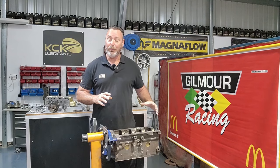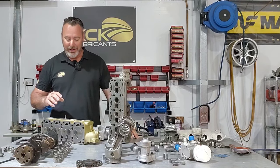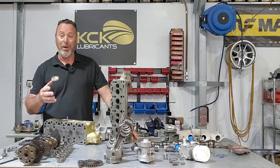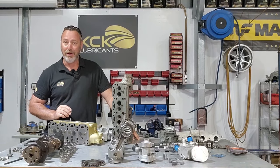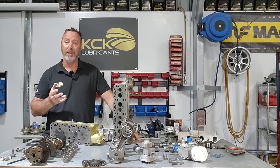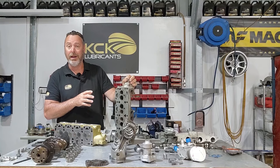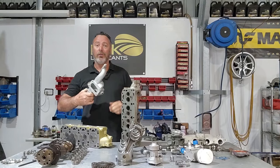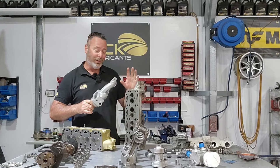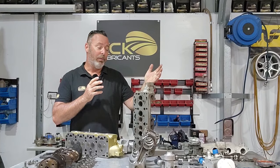Once that's done we're ready for masking and paint. Unfortunately the cylinder head that came with the engine is basically unusable - the ports are way too big for this engine. It's a 1.6 litre engine with essentially a standard camshaft; you would need to do 8,000 revs for that cylinder head to work. So we've found one of our old cylinder heads that we've actually raced with - it was quite competitive but we came up with a better one. We also have the matching intake manifold for it that's been port matched, everything's to the rules, and we'll get this remachined and painted while we paint the block.